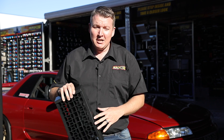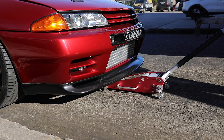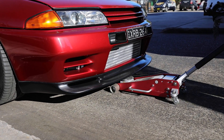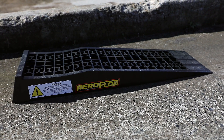It's not always easy to get a trolley jack or a floor jack underneath the front of a lowered car. Most of our viewers are going to have some modified vehicle — it's generally going to be a bit lower to the ground. So you've got your traditional trolley jack and you try to put it under the front lip, and there's just not enough clearance to get all the way to where you need to jack the car up — to a jacking point or a solid cross member or something like that.